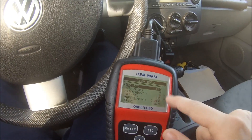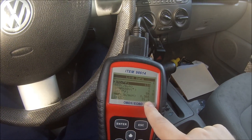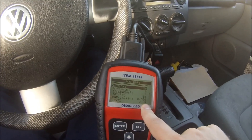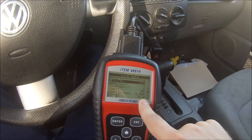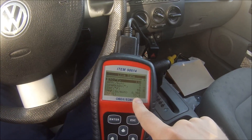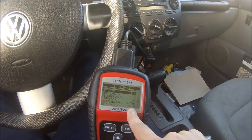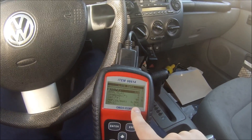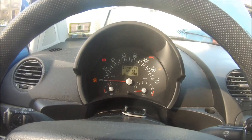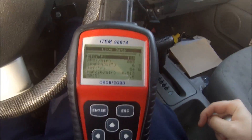What you do is slowly ramp up the pedal and you'll see this value increase. Slowly bring the pedal down to full throttle. On your automatic transmission version, you have a plunger on the bottom of the throttle travel that tells the gearbox to downshift — you then depress that, and now you get 77.3. Then you slowly ramp off the throttle until you're completely off the pedal and it displays 3.5 again. Then you give it a start and you'll see that everything is running normally again.